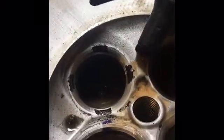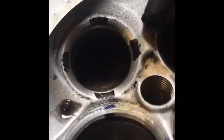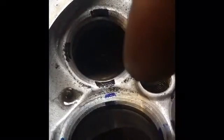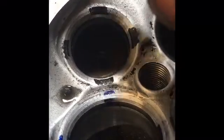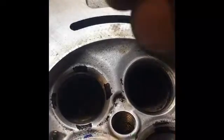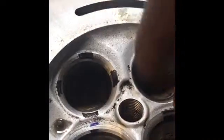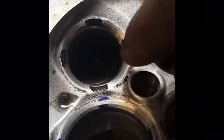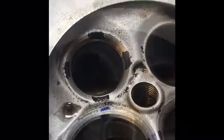Okay, once again, we want to see our 45-degree angle, so we'll clear off the coolant and water, add in more Sharpie over the existing, take our 45-degree grinding stone with the shaft installed so it's concentric, and then we'll see and make sure that our 45-degree angle is still within the right thickness.